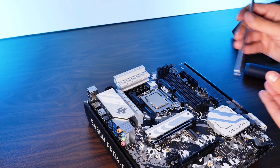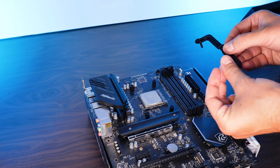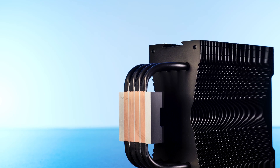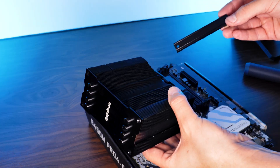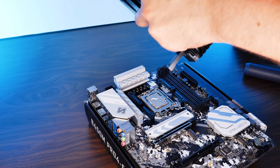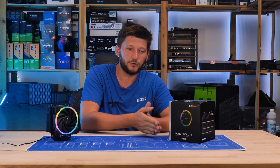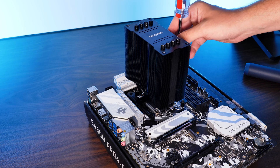Over on AMD's side, it's a bit less involved. Remove the pre-installed retention brackets, position the spacers on top, followed by the brackets in an inward-standing position, and screw everything down. On both platforms, remove the protective covering on the base, because there is thermal paste pre-applied there. Slap it on top of your CPU, and then you can start your endeavor full of pain, suffering, and the urge for retaliation — that comes in the form of the central mounting bridge. The Dark Rock TF2 has a good bridge; use that one. After you've got that on there nice and flush, screw it down on both sides.